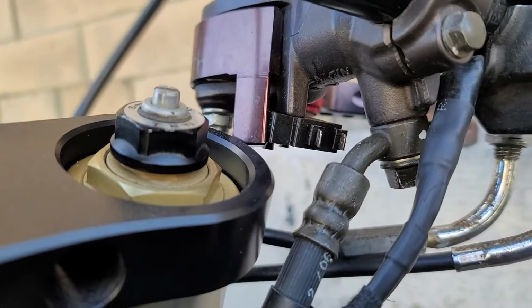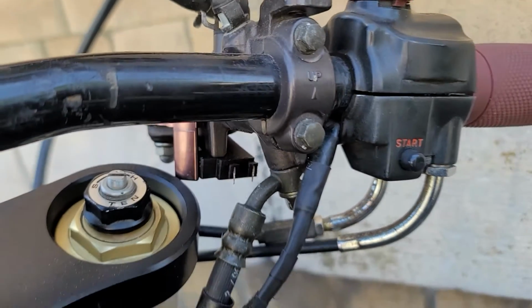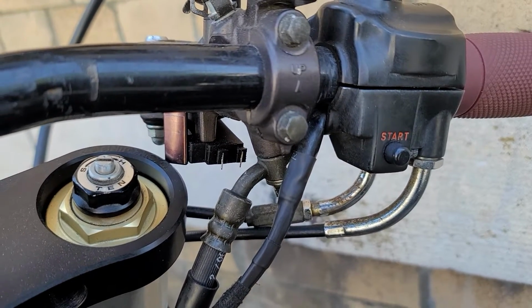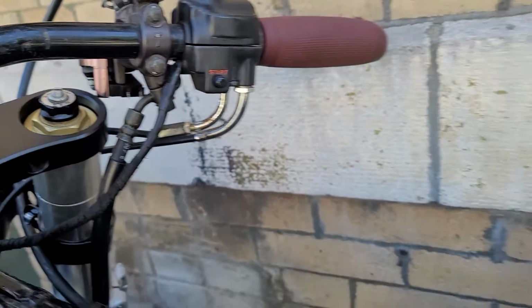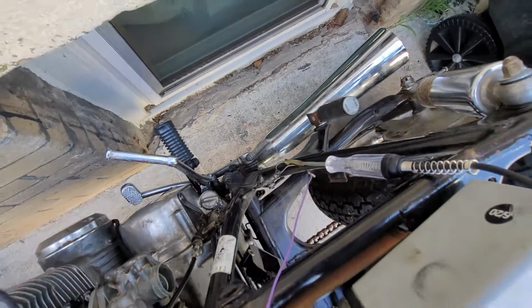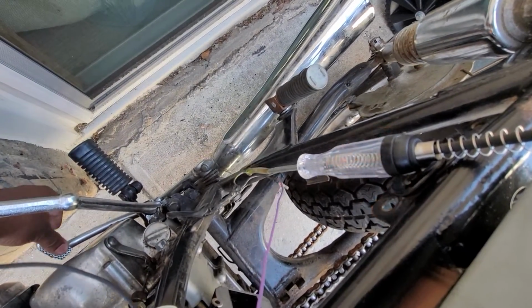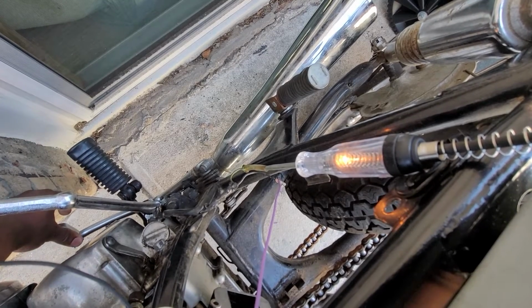the grounded frame. For the front brake light, you just use the 2 wires connected to the switch that every master cylinder comes with, and again, you just run ground through one of them, and you pull the brake, and ground comes out the other one. Here, the test light is hooked up to positive, with ground running through the switch to the needle of the light. Ground makes it to the light when the brake is pulled in.